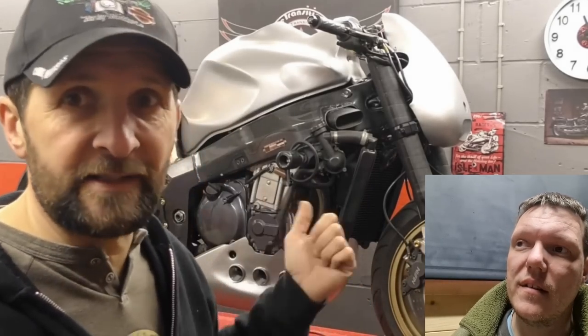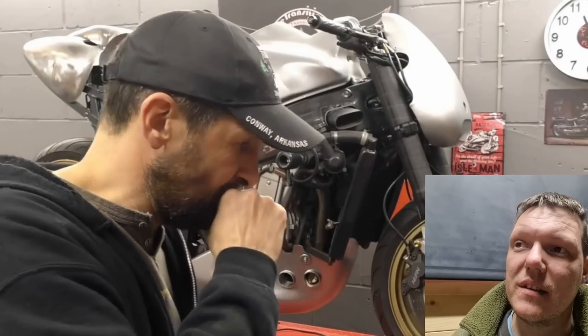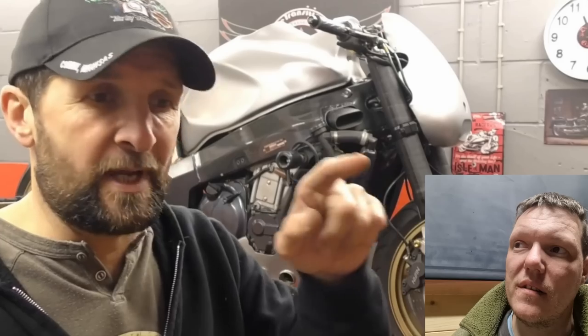What's next? Right, the next thing is on the belly pan, on the tail panel at the back. On the tail panel, I've just got to weld up the 3 holes, which are the filler caps of the original tanks, and then smooth them over. That's a reasonably detailed job. I've got to cut out the lip that remains there, make a little patch panel, patch it in, weld it round, grind it flat, and make a good job of that.